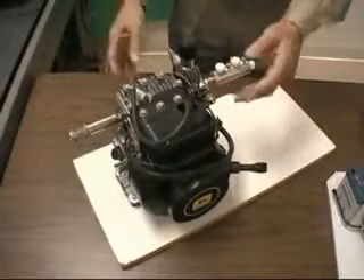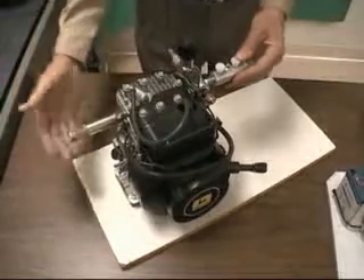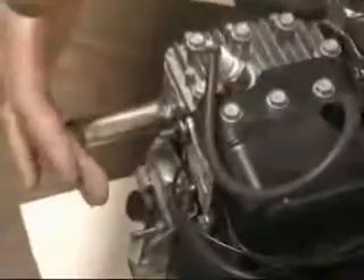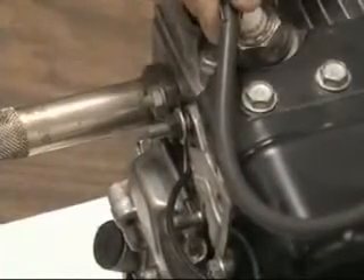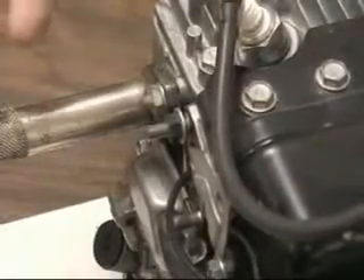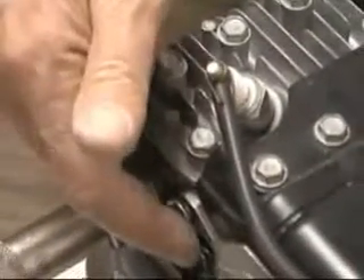We're showing how to make a very inexpensive conversion by removing the carburetor and letting the engine breathe without restriction — all the air it can get on intake — so it'll have more air in the compression stroke and more air available for burning more fuel. This is the 5 horsepower John Deere shown now in the least expensive conversion mode, just using a delivery tube to bring the hydrogen right to the intake valve port.